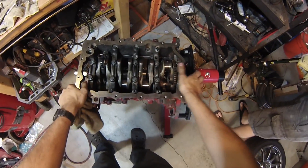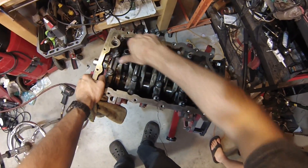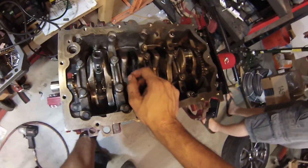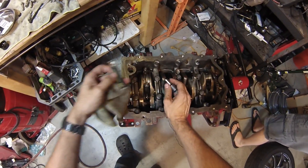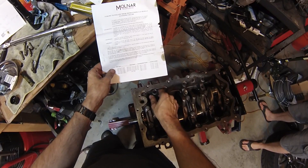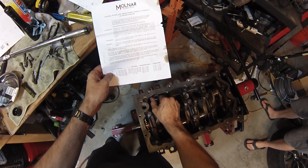Alright, so we've got all the pistons in. We've rotated the block and we're starting to assemble the connecting rod bottom caps. I just push up on the piston until it connects to the crankshaft. They have this special lube for these race bolts — I put that on the threads and on the head and we'll start tightening them down. The torque value for these is 25 foot-pounds and then turn an additional 55 degrees.